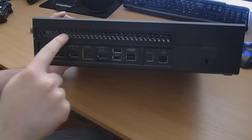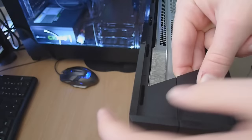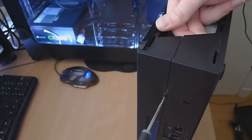At the back, we're going to start prying it apart. What you want to do here is pull up on one side, push down on the other side, and kind of push outwards a little bit. You can see it's coming apart - that's that clip off. Try and keep it separated like this while I grab a screwdriver, and you need to unclip the clip at the warranty sticker.